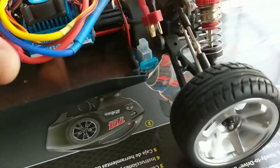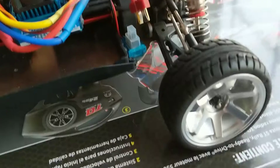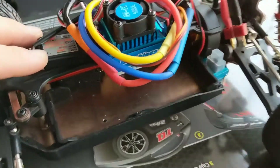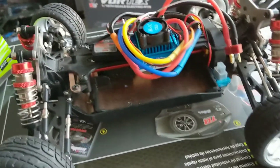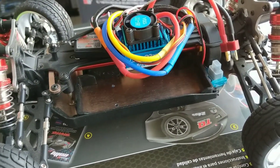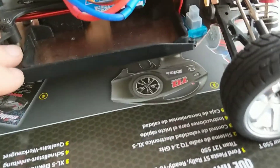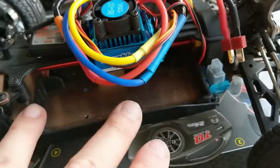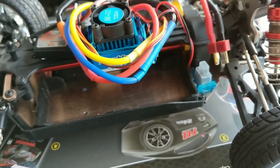I did adjust the shocks to accommodate this motor, which does seem a little bit heavier. I went ahead and put my FlySky multi receiver in there so I can use my transmitter on this as well, and I spaced it out to hold a bigger battery — going with a 3S setup.